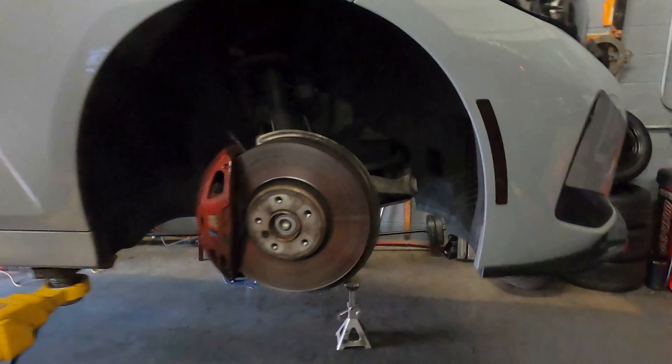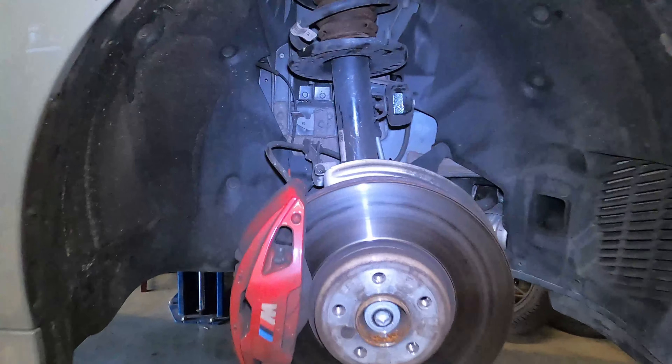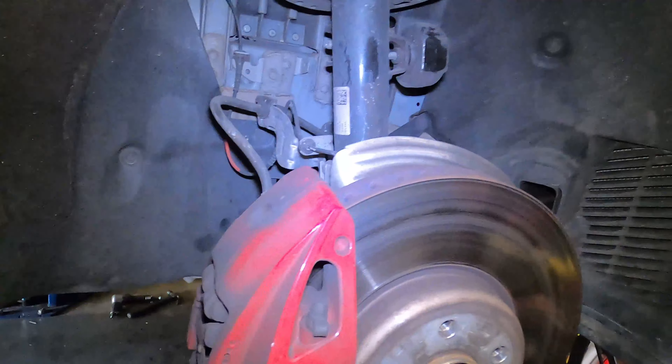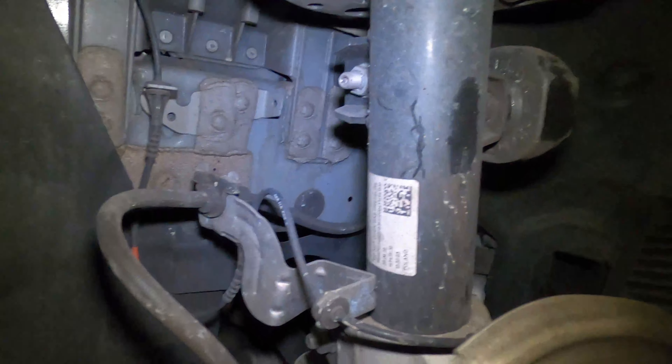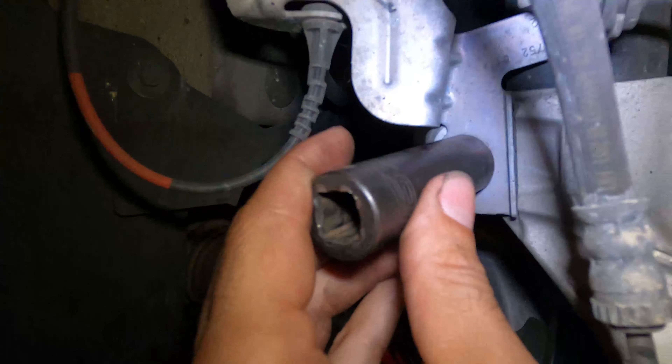And just like that, that's how you do the rear. With a few tools, I kid you not, you can bang that out in 15 minutes. Torque everything up — I'll put the torque specs in the description. Most importantly, torque everything under a load. If you don't torque it under a load you're going to mess up the bushings and won't get the right ride height.